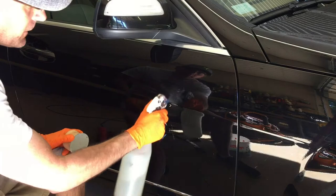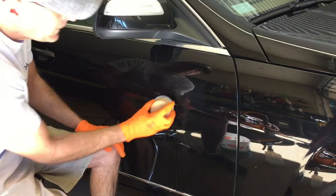As you can see here, the area is not very large, but what's going on within the area is gouging, a dent, marring, scratching, some transfer. Right now we're going to take care of the transfer, the scratching, and the marring. That's going to start with wet sanding with a 1000 grit Trizac disc.